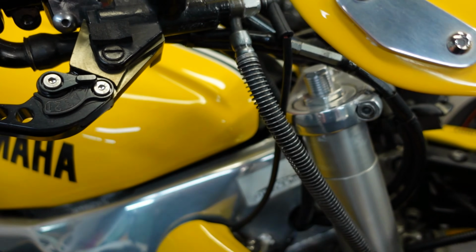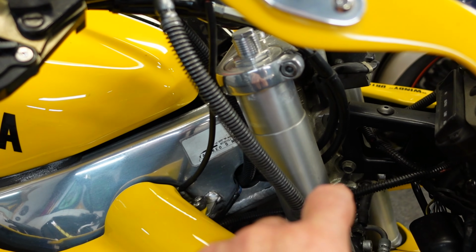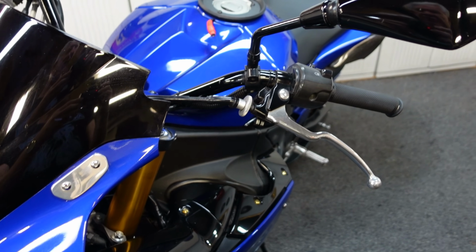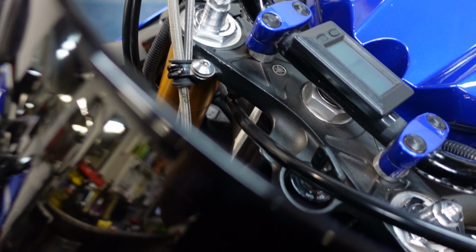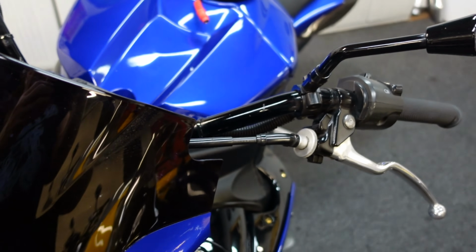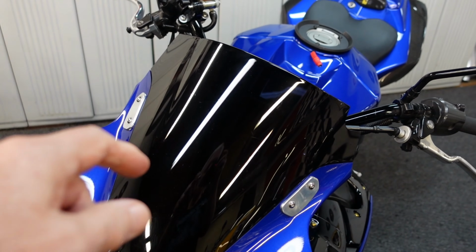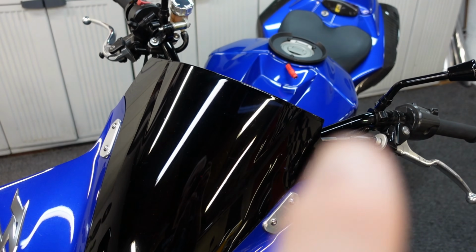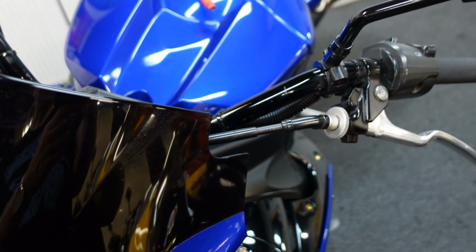On a bike like the FCR, you don't have to add anything. The hose was plenty long, but again, each bike is going to be different, but that's one dimension you have to take into account, or you may have to buy a longer hose. Number one. And when you originally set it up, you find out, in some cases, not all, the clutch cable needs to be rerouted. That's a stock clutch cable, but I took the gas tank off and rerouted it through a different set of little valleyways to get there, and I did not have to buy an aftermarket clutch cable. But I'm thinking if I had to, probably the one from an MT10 is probably a direct replacement. But in this case, I did not have to buy that. That fit fine.